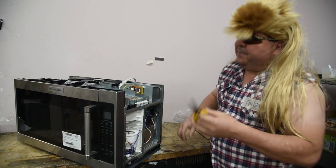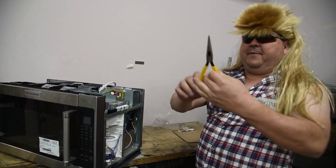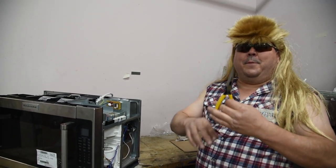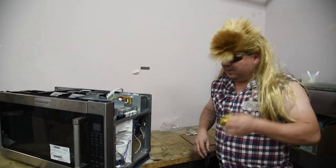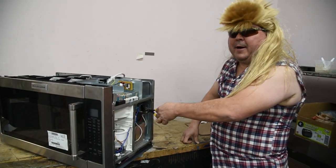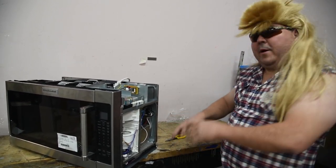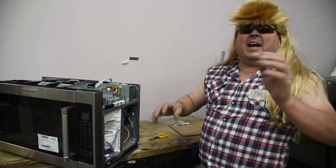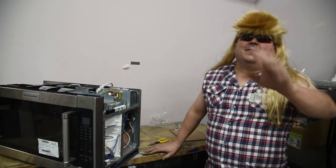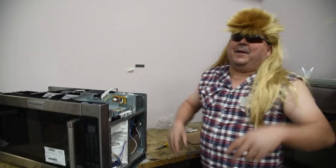Basically, take your thing. Now, if you got the ones at the front — the German pliers that have the big old long ends on things with that steel metal — don't use them thingies. Use these. And basically, just go in and touch top and bottom. That will discharge your high-voltage capacitor. Now, like I said, there's a lot of things in here. There's a technician out there named Keith something or other that was talking about space-saver washers and dryers. Well, I'm going to show you the original space-saver washers and dryers.